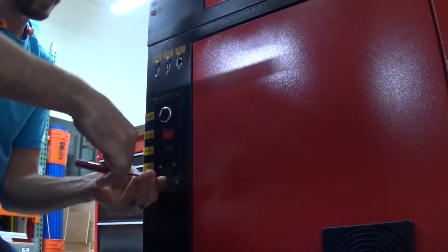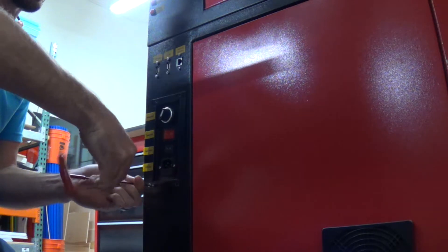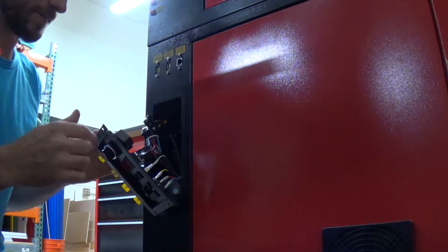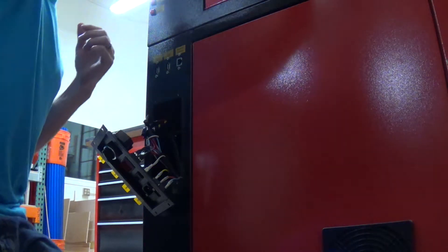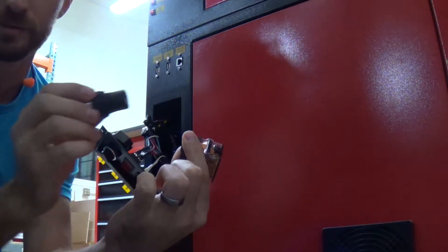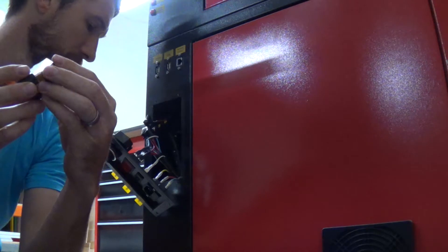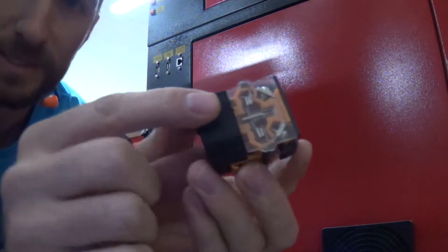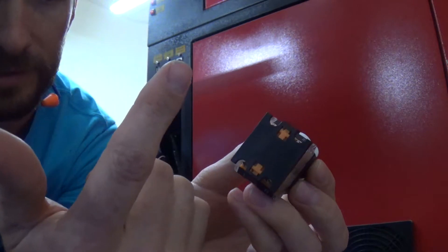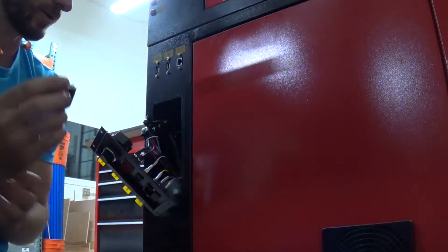Finish removing this control panel. I just bypassed that before. The switch head has two parts. If you depress this white tab here, you can pull the rotary knob right out, which is nice because I don't actually have to reinstall that portion of it. What had happened was these insides on both sides had just melted — it took away the option to connect, because the connectors were melted into the plastic and couldn't make contact.